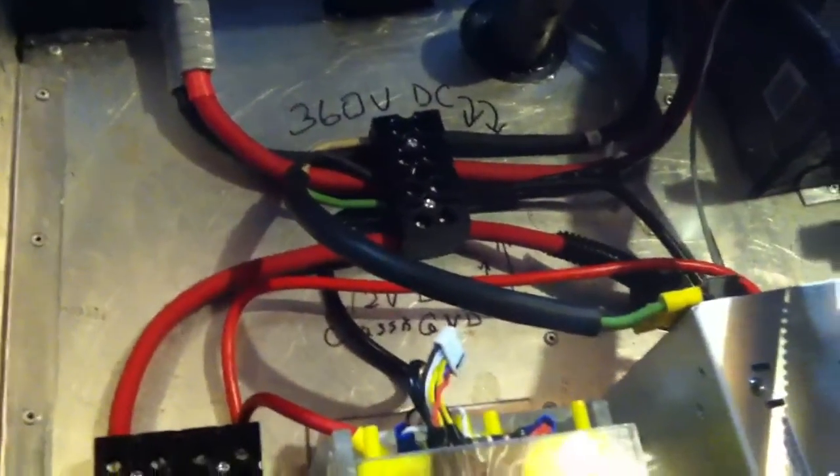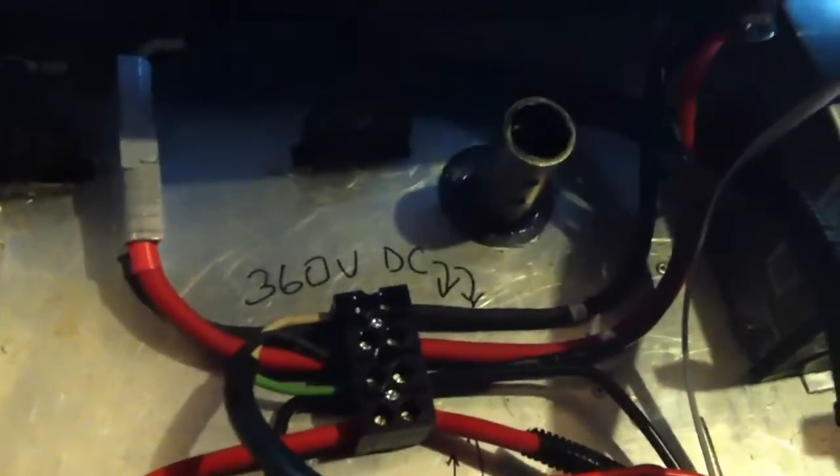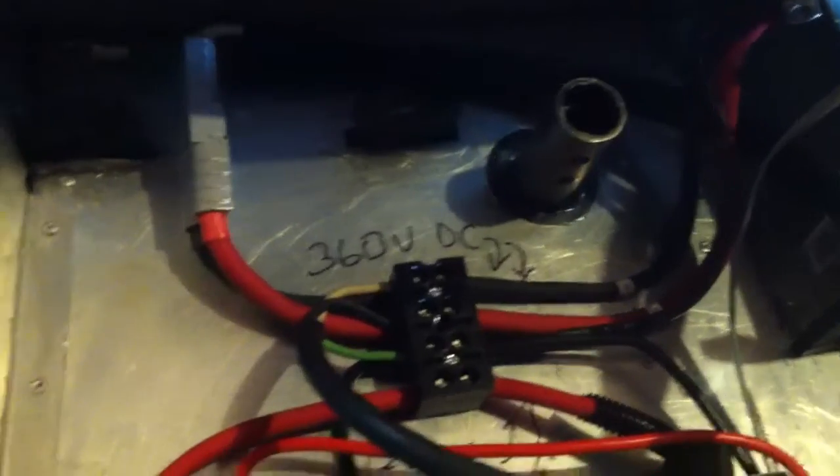You can see where I pulled the 12 volt and high volt wiring together — the 12's on the front two connectors on that block, and up to 360 volts when the packs are fully populated. It's only about 130 volts right now. I also put in a little switch down here — the master turn-off switch — and the main 40 amp fuse for the 12 volt system in the car.